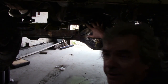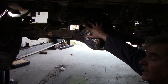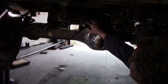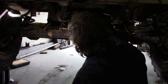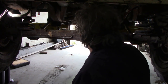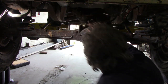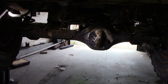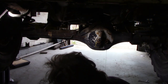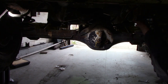Other things we observe while we're looking under here: the A-frame joint has been changed at some time, and the rubber's looking a bit worn in here. We're also doing observations for inspection - the shocker bushes need to be replaced, they're a bit split.